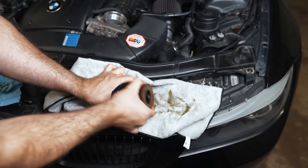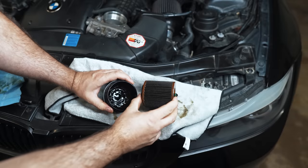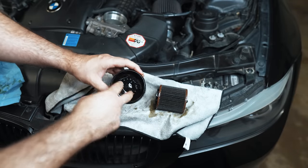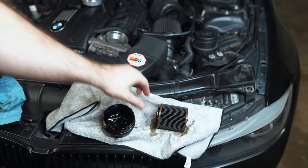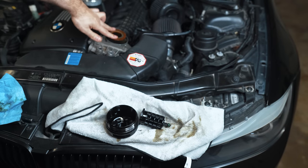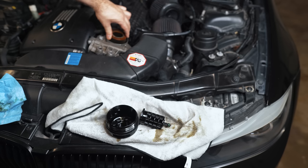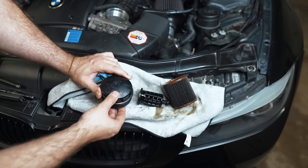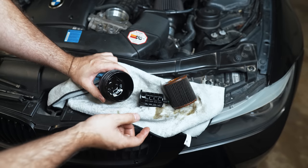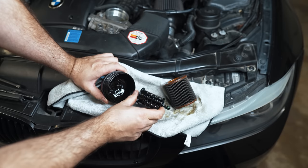Let me simulate what actually happens. You pull the filter off — boom, so easy. You take the old filter and throw it away without a second thought. You bring the new filter, realize it doesn't go in, so you go for the housing and there's a perfect place to stick it. It will self-center and you wouldn't even think about it. You'd find threads online where people bought a used car and realized the cage was missing because they actually know a few things about BMWs.